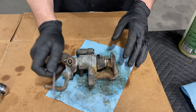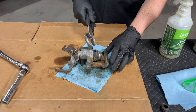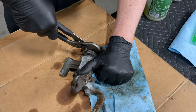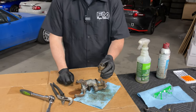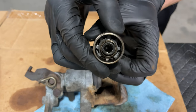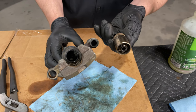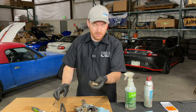There's not a whole lot of room to use the wood block trick like on front calipers. Now that I've got it fully extended, I'm going to use a pair of channel locks, grab onto the end of that piston, and wiggle it around until I can break the piston free of the bore. You can see the backside of the piston has a threaded body — so we have to unthread the piston through. Don't be worried about scratching up the piston; you're not going to reuse it.